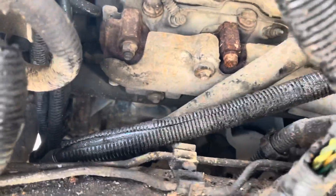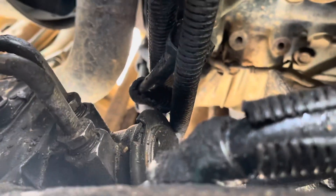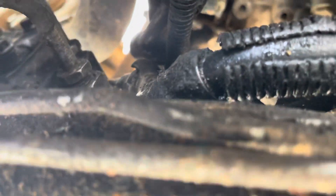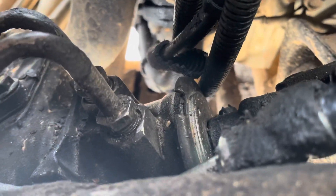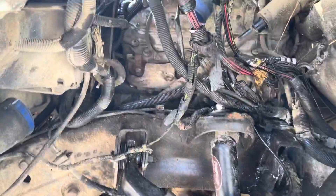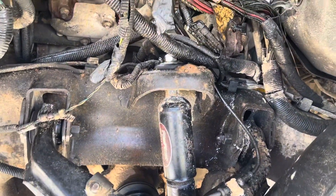It comes from the brake booster. Let me put the cell phone so you can see — the power steering gearbox is right there. This is the line. You've got plenty of room to put the wrench on it — I think it's an 18mm. This is how we start removing the line and put a new one.